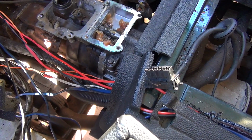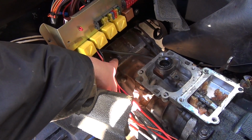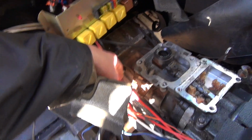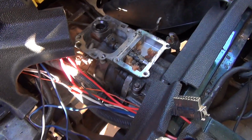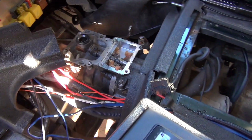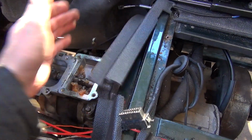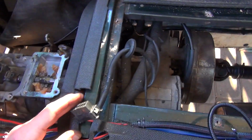Need to loosen the gearbox mounts and the clutch tunnel bell housing, and then it should slide back this way and then drop down. In theory. So far it hasn't proved to be exactly true. In fact, this carpet, I can't tell you, fuming with this thing. If you don't have the carpet, you're really going to make some good progress on this very quickly indeed.